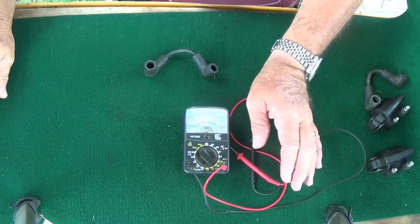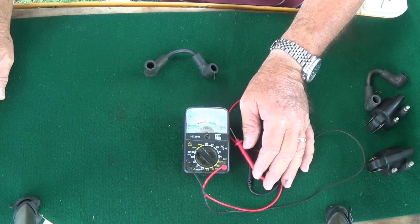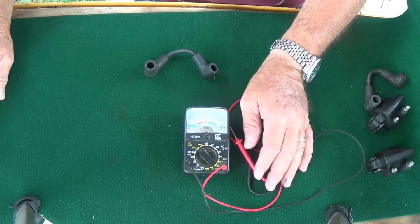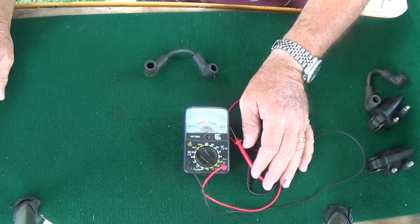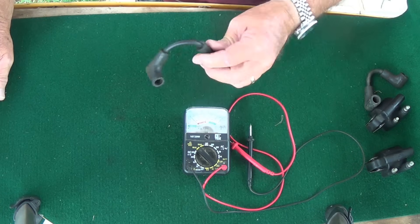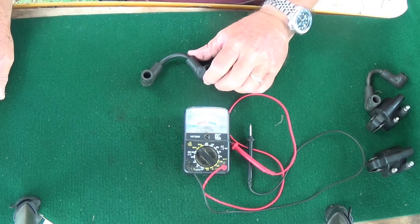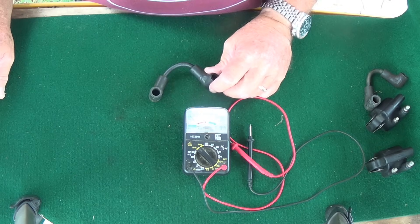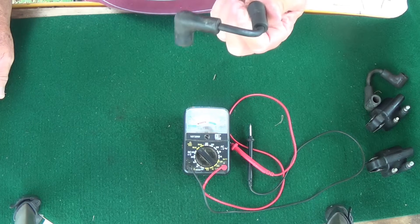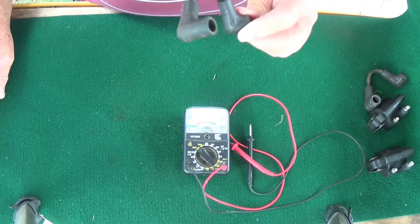That's why it's easier to diagnose with the coils removed. I could have probably done that while they were on the engine, but there are a lot of reasons to take them off. We'll be replacing this one — probably replace them both when I order; I'll just order two. The engine runs, but on the ohm check it fails.